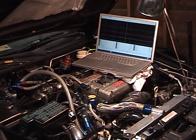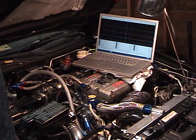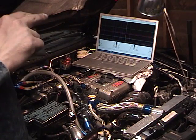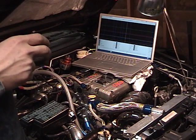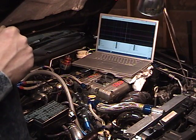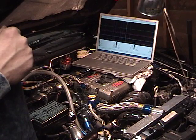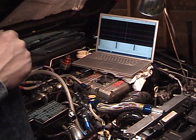We went from 4.43 to 4.84 volts just from adjusting the throttle linkage. If the throttle position sensor doesn't lie, that means the throttle plate is opening farther. On a turbo Mitsubishi it's hard to check the throttle plate position without taking off the throttle body elbow and physically looking through it — that's the best way to test it. But this is the best we can do with everything bolted together. So if you get those items straight — throttle plate closing fully, TPS adjusted properly, and throttle linkage allowing the full sweep at full throttle — you're in good shape.